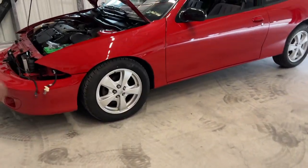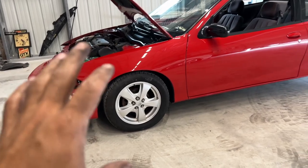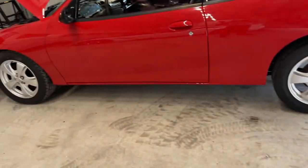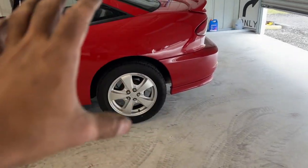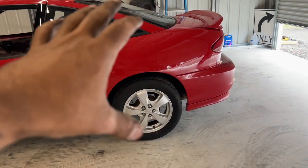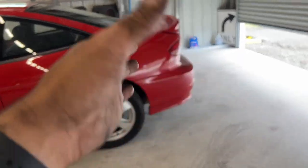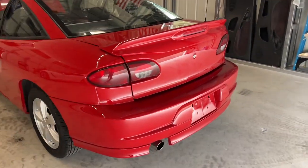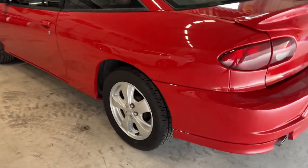Another day, next clip — got the Kevlar on. You can see it's a little bit different. It's slammed — well, I call it sport line, not slam slam. We lowered it two inches in the front and 1.8 in the back. The back of this car is a lot lighter so it's not going to go down as much, but maybe we'll stick some subs in the back and that'll lower it a little more.